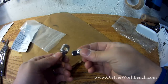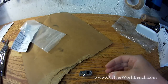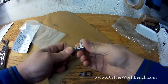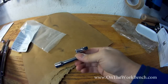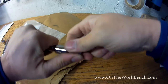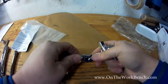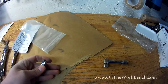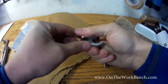What these allow you to do is make a 90-degree turn in your extensions or whatever you're working on, to make various combinations that are otherwise not possible. So if I've got a 3/8 extension, I can put this on the side like that, flip it on the side again, and then continue on with an extension like that, adding an offset.